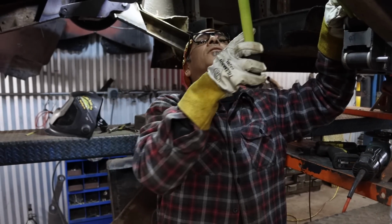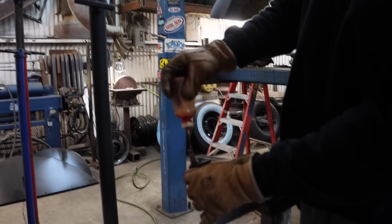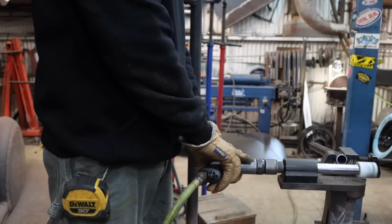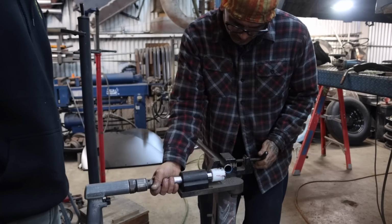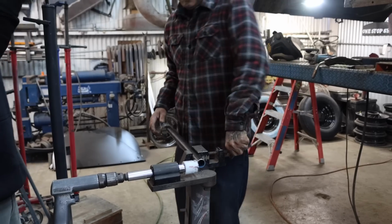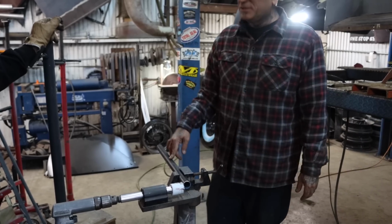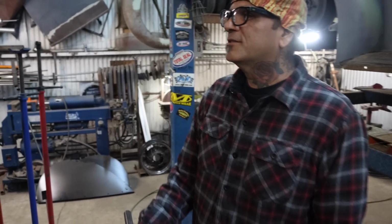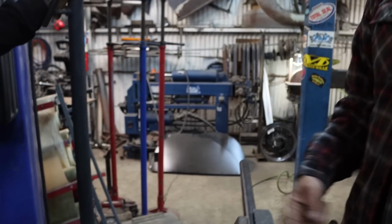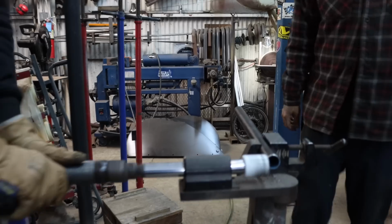This should all be the same, bro. Bam. What is the center to this guy? How do you get the notch? Because the tubing is really thinner than the actual notch, you don't have to put it in the middle. You know what I mean? So I kind of measure just a little shorter than in between. Go ahead, notch it. Don't stop it.